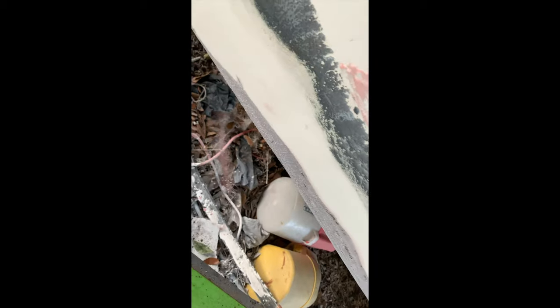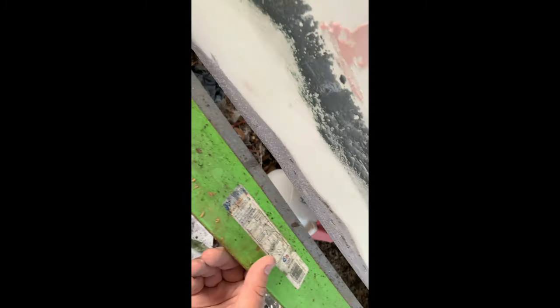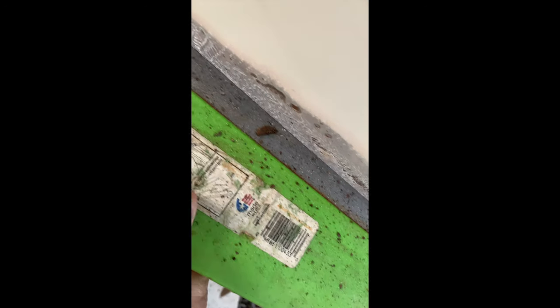I took the razor, cut those out, and here we go — real quick, checking it with the straight edge here. This is what I do to make sure everything is completely flat. No light gaps there to show that we're uneven. And I was surprised with myself — it came out just perfect, dead on. Now we are ready to start fairing this thing out.